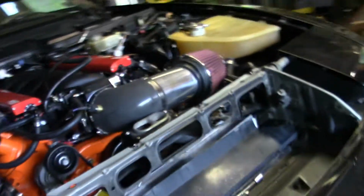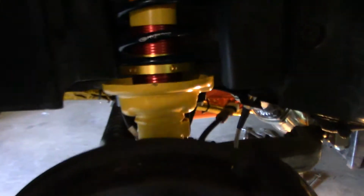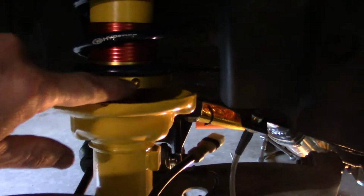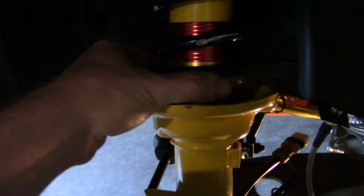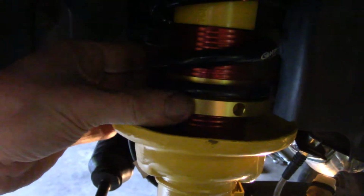That's right, I'm going to figure out what kind of ride height we adjusted at, because these are adjustable. Okay, I think I set them both in the middle. You have a spanner that hooks in here, and you can turn this. Actually, with it up in the air like this, you can turn it by hand. But yeah, and there it is. That little nylon screw is the locking screw.